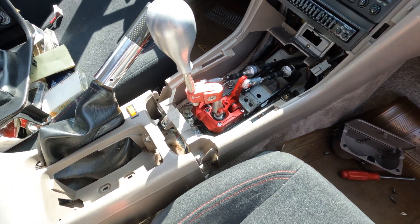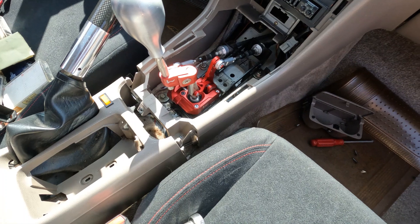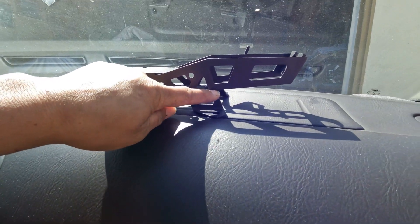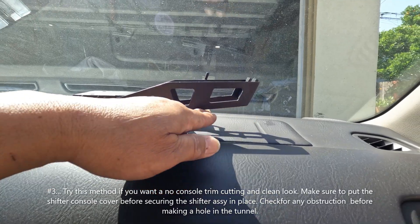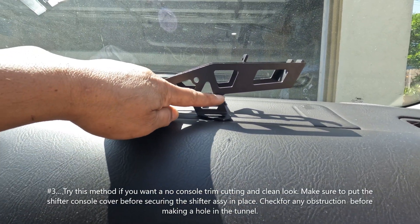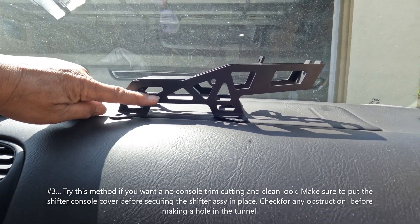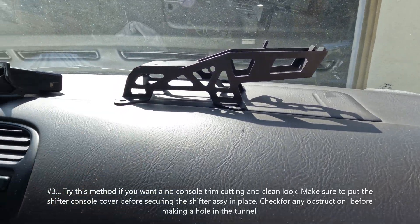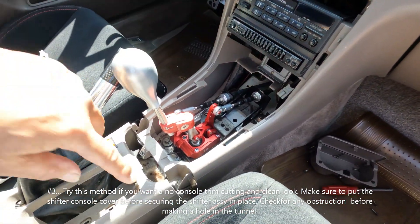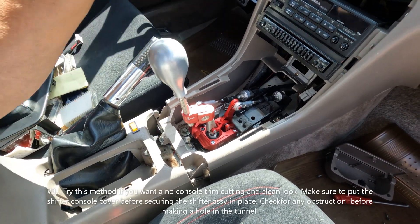My recommendation: if you don't have access to welding equipment, pay a shop 50 to 60 dollars to have it welded. Follow this line right here by my finger — make sure it is square. Cut it right there, cut the ear off, and weld it right there. Once everything is welded, drop it on, put in four bolts, secure it in place, and you're good to go.